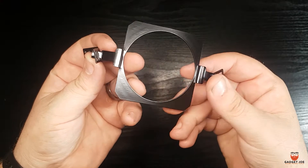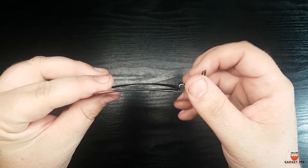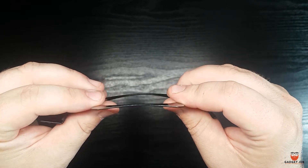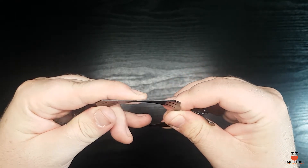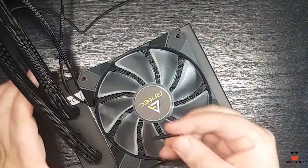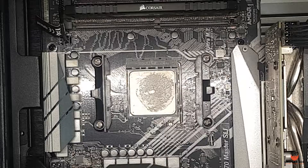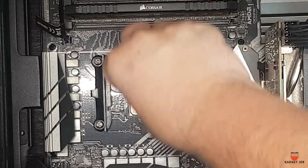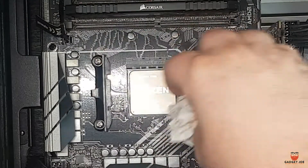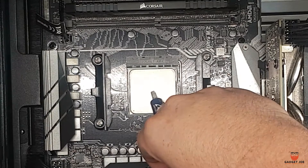For this video we're going to be using the AMD mounting kit on a Ryzen 2700X, so we'll be using the AM4 mount which is simply a small metal hoop that fits over the cooler. Installing the fan is super easy using the included screws. When it comes to installation, make sure your CPU is clean of any paste — isopropyl alcohol works well for this. The cooler does come with pre-installed paste, though I like to use my own.